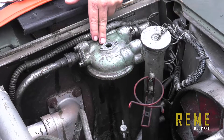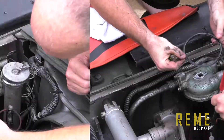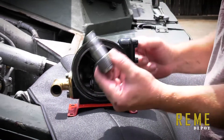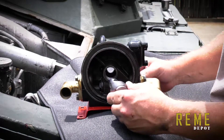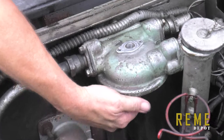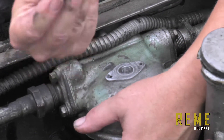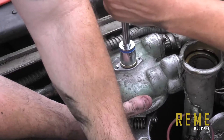There are three things we have to do to the original oil filter housing: clean the top so you get a good seal for the new adapter seal, remove the old seal, and then inspect the inner ring. This new adapter goes in like the previous designed adapter, except it now has four holes so there is no lineup requirement and no chance of oil not passing from the filter to the motor. Just slide it up through the original housing hole — it should be flush. The new bolt comes with a flat seal and a compression rubber seal. Spin this down and torque to 40 foot-pounds.